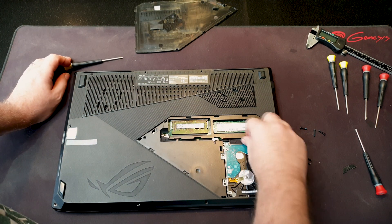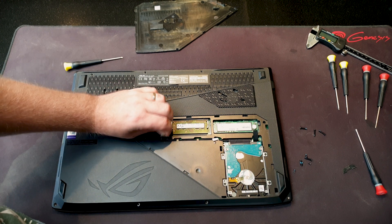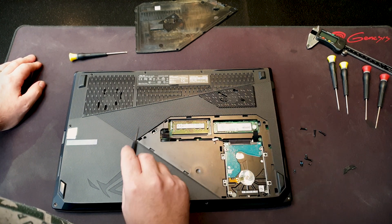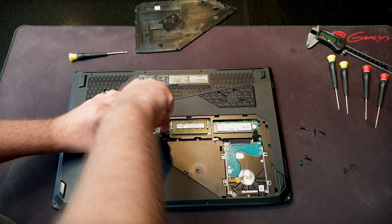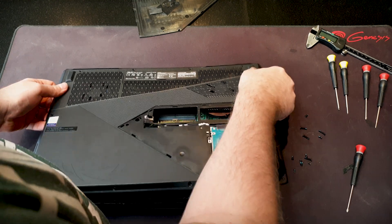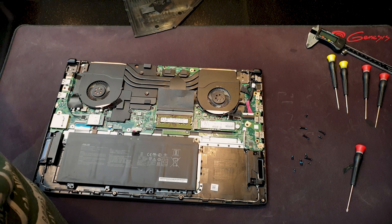You can remove the hard drive by pulling it out like this. Now we've got the cover off. We still have a few more screws — right over here, here, and a third one over there. Let's do that. It needed some persuasion. Just be a bit careful, and you can put that aside.